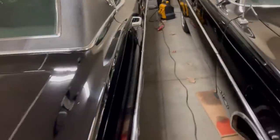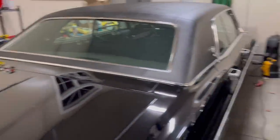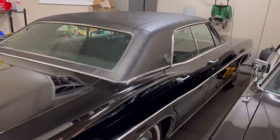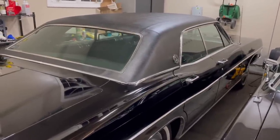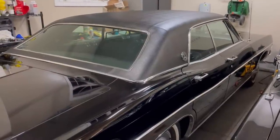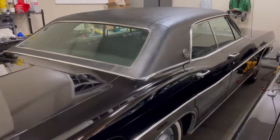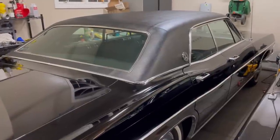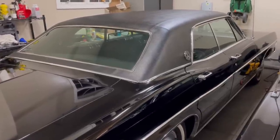Thanks again for watching — it just looks like glass on many of these panels, it looks great. Stay tuned for more, especially as I go through the mechanicals. This car needs a carburetor rebuild: a new power valve, the accelerator pump — you step on it and it dies, it stalls out when you step on the accelerator. It's running pretty lean; I think the power valve is stuck. I've got a carb kit coming. This is a two-barrel car, and these Autolite two-barrels are super easy to repair and rebuild — kind of an hour job. Stay tuned for more.